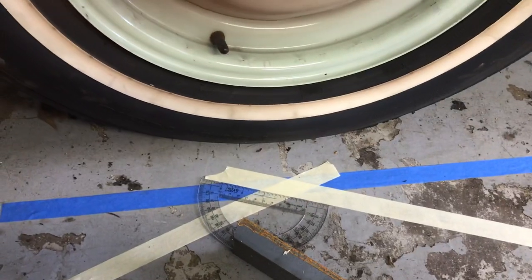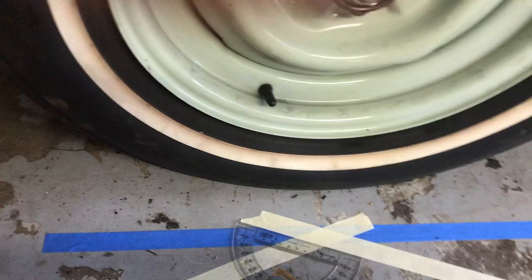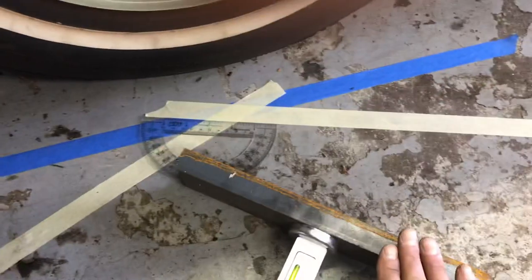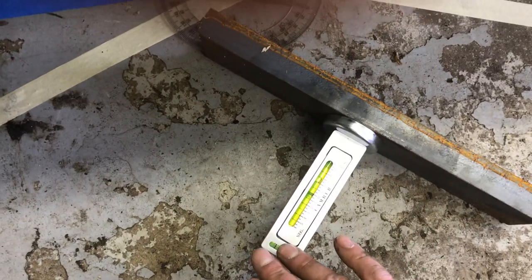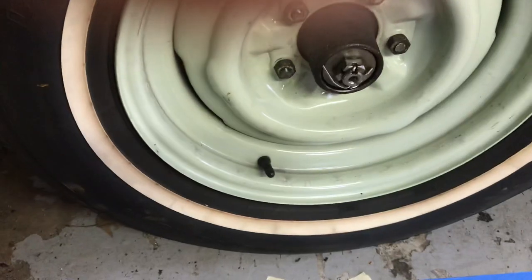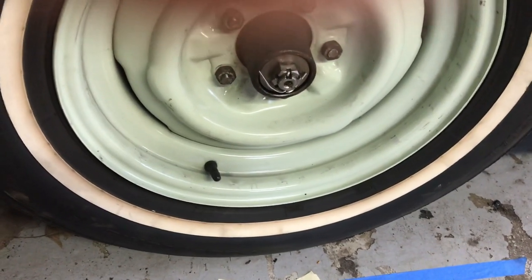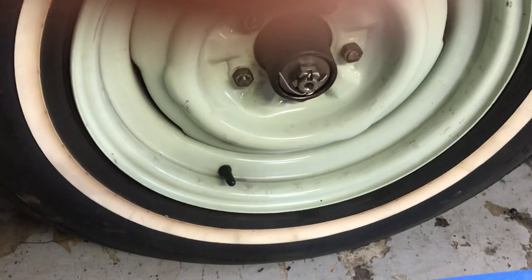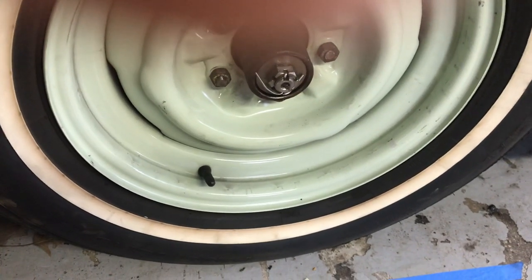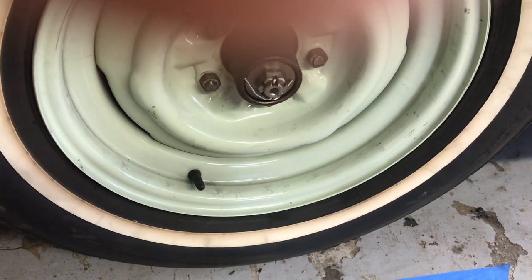So this is how you tackle caster — the most difficult one. Camber is pretty easy: you just have to have the device stuck to the hub and measure it, making sure it's calibrated to zero when you start on a flat surface. It's not exactly a very straightforward process, but if you've got any questions, ask me. I'm by no means an expert, but I've done my own alignments and they work great. So if this helps you, give it a thumbs up and subscribe — I've always got crazy DIY stuff going.